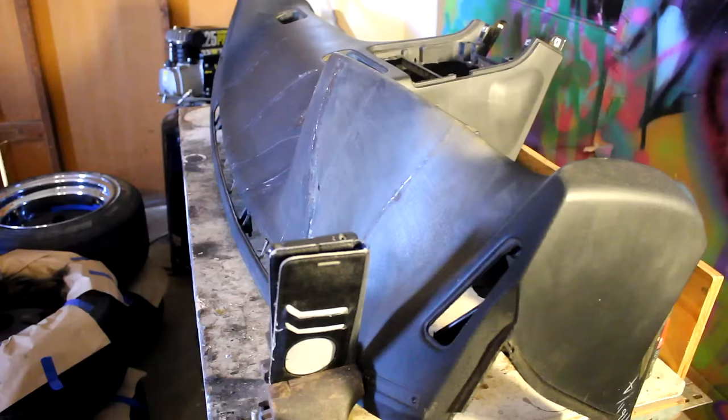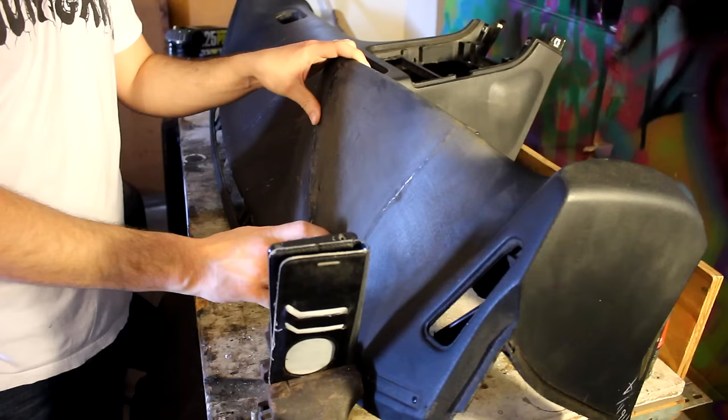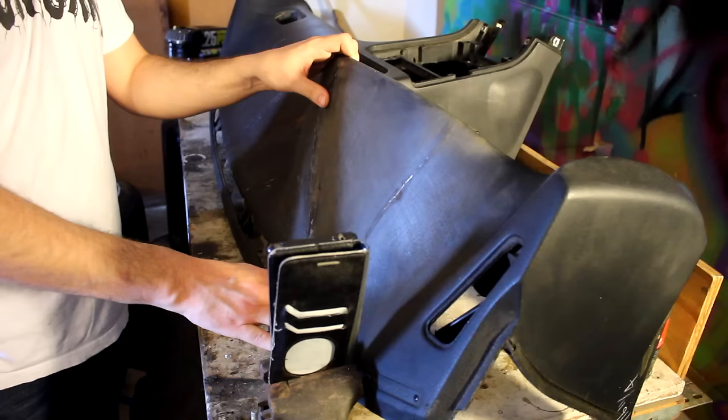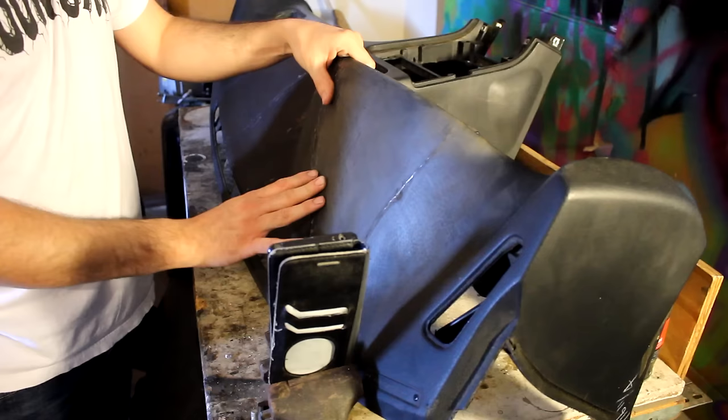This weekend, I started off by trying to fix my dashboard. I tried to patch these cracks with amazing gunk or goop or something like that. Because it doesn't harden as hard as Bondo would — and I know a lot of people use Bondo — I wanted something that would kind of flex with it. However, it did not cover as well as I would like, and when I went to sand it down, it just peeled out. So what I'm going to do is finish sanding it down, take my Dremel to get the cracks as far down as possible, and then lay down the Bondo.